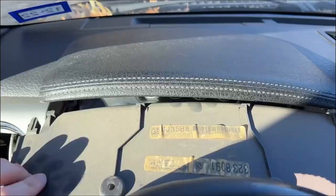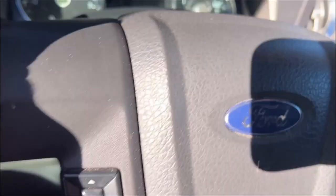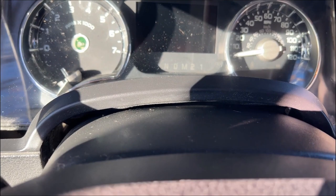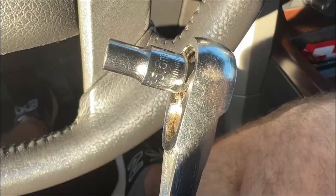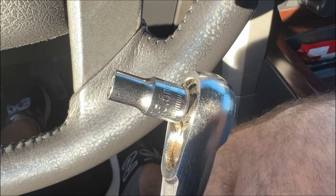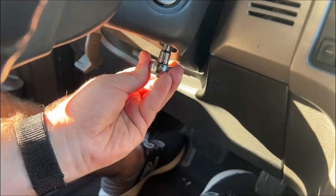I'm going to try to use both hands so I don't scrape up any of the interior. I have the top part out and the sides. I had to lower the steering wheel with this tab right here. I noticed that this bottom portion is attached by this rubber mat — I think I'm going to have to take off this top part to take it all off in one unit so I don't rip that leather piece. Underneath there are these screws — one, two, then a third. I think that's a six millimeter, but I tried a five-and-a-half from my kit and it fits pretty snug, so I'm going to take those three off with the five-and-a-half millimeter.